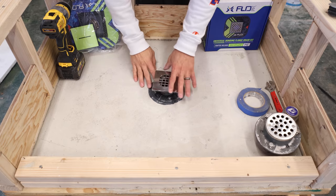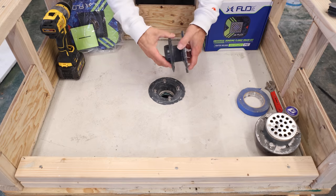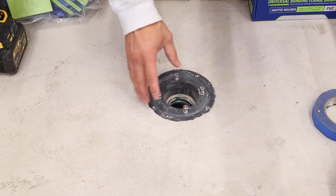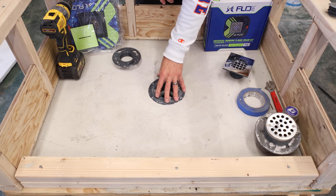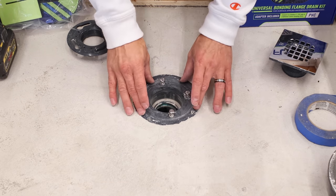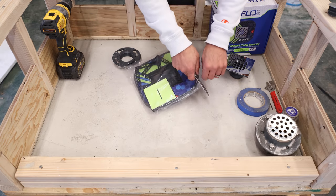The first thing I'm going to do is take the three-piece drain off. This is again three pieces — the bottom flange is installed typically in concrete or screwed down to a wood subfloor. What's nice is if this is already in here, you're not going to have to bust up any concrete to get to the stub out below. We leave this bottom stage in.